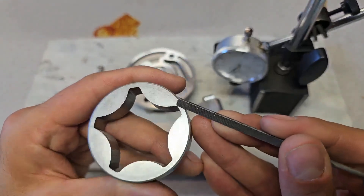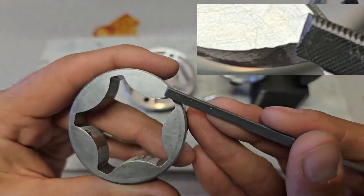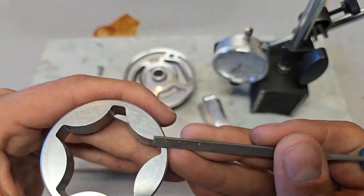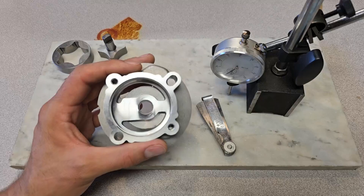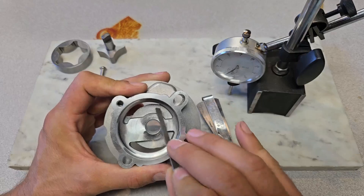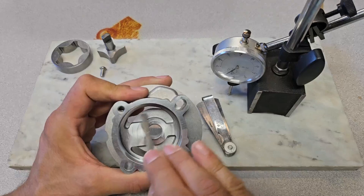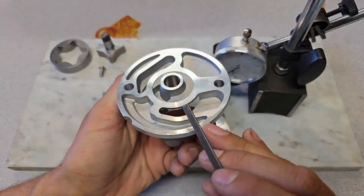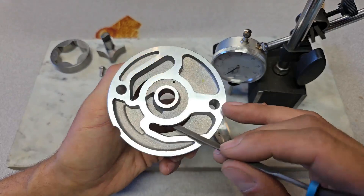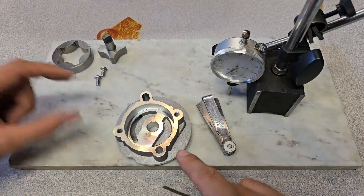I ran into a little spot here — you can see in the reflection it's a slightly coarser area, probably scratched during the machining process. You can even see small scratches running lengthwise in the reflection. The file will just catch on it and that's how you know you found a spot to deburr, so I'll dress this off. Moving on to the main housing, same process — just knock down any potential burrs along any of these ridges with light pressure.